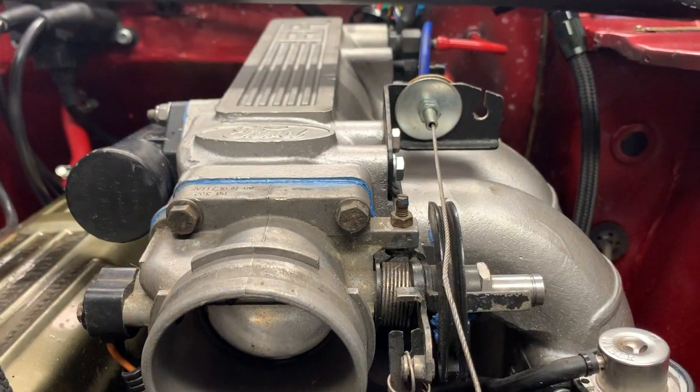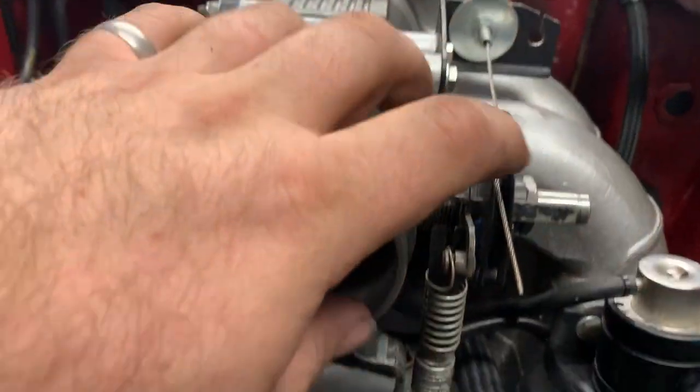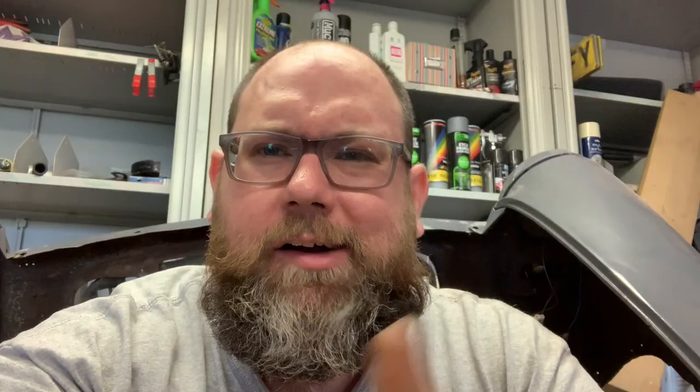Next job is the throttle cable. I'd got the routing sorted out before but never actually fitted the cable, and as I've shown in a previous video I modified the pedal box to fit the throttle cable, so I'm going to get that fitted now. I could do with some better washers to sit either side of the bracket, but they'll do. I just need to get a nipple on the end — I've got the one I used previously stored somewhere safe, so I'll put that on at some point. The car doesn't even start yet, so yeah, another little job ticked off the list.